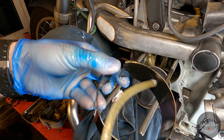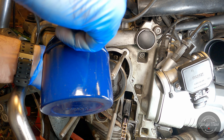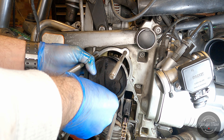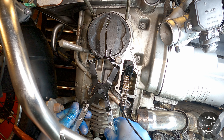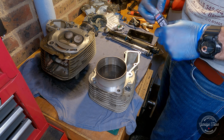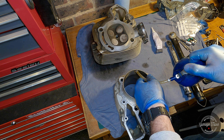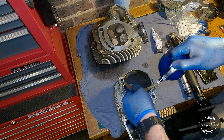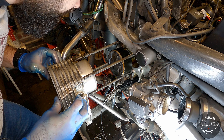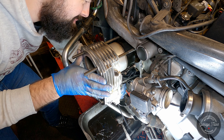I'm going to start by getting the piston ready. I haven't touched the rings — they're in the same position. I'm just going to put the ring compressor in place, so that's ready to go. A bit of oil everywhere to make sure it slides in easier and prevents any damage. Now it's time to apply some sealant on the bottom of the cylinder, and a bit of oil in the bore so the piston slides in easier — I'm probably putting too much, but it's fine as long as it doesn't touch the sealant. Starting to put things back together: line everything up and make sure it starts straight — the piston should slide in and push the ring compressor out of the way.